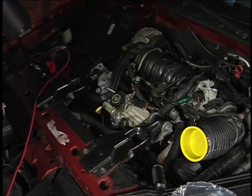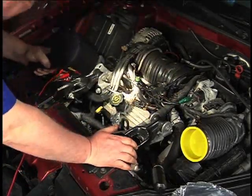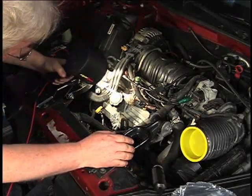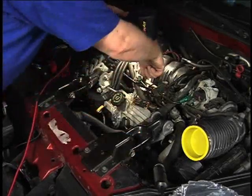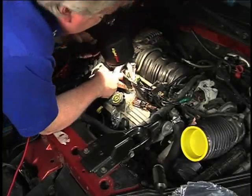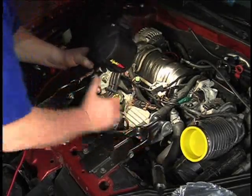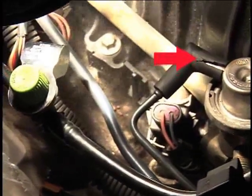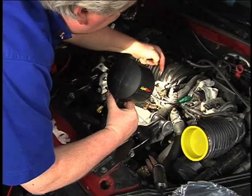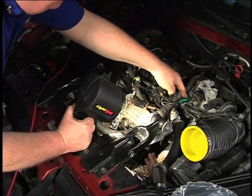Lo and behold, we've got other leaks. I've got a leak — something serious here. I've got a leak at the intake manifold, leaking straight out from an intake manifold gasket. And I've got an injector — looks like number two injector is leaking around the O-rings. And there's a little bit more — I've got a split right here too. It was holding when the other leaks were leaking, but now it's leaking a little bit around the split. So we definitely need a boot, injector O-rings, intake manifold gasket, a fitting on the intake, and a new valve cover. We've got some work to do here — and a good sale too.